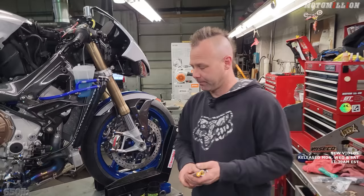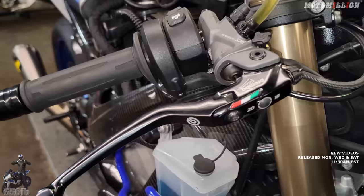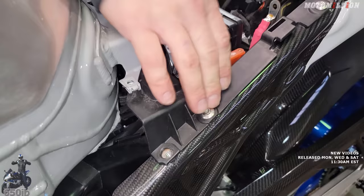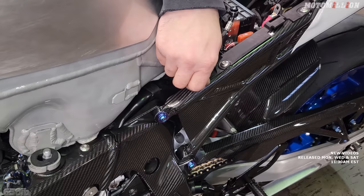Still working on the little things. We got a TWM clutch lever that'll match our Brembo brake lever better, but I think we're going to leave the Brembo lever because it's so nice. We got some bolts we could put in the subframe — if you were watching carefully last time, remember a tap broke off in this screw. I was able to get the tap out, re-threaded it, and put those fasteners in. I was able to crack the tap by hitting it with a pin punch and then re-thread it, and now it goes in nice like it should have originally.